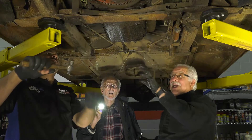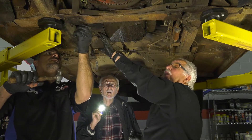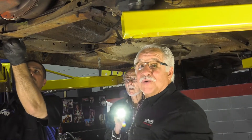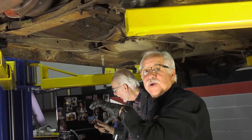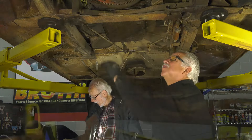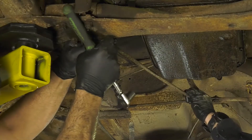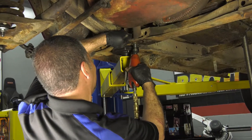What's important when tapping a bolt out is to leave the nut on it with enough threads so you can tap it without damaging the threads. A lot of people pull the nut off, start to tap, and destroy the threads — then you have to chase them. We've now gotten the linkage and emergency brake cable out of the way and we're ready to drop the crossmember.